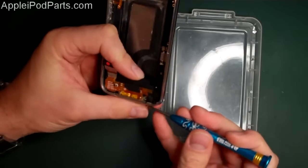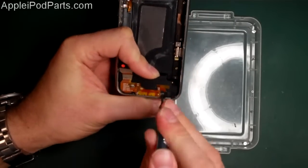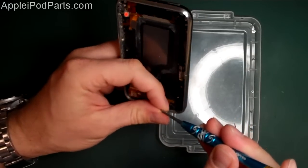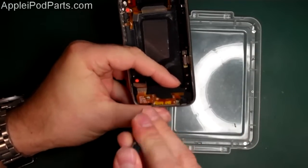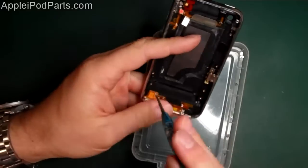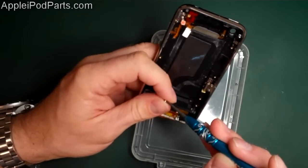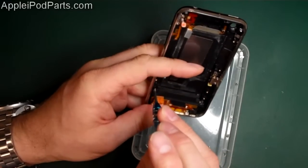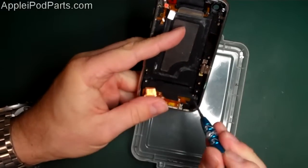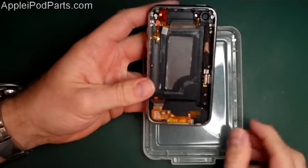So we're going to put the little screws in there. I'll put them both in, but we know that with the left-hand side the brackets come off, so that's not going to do much good, but it's better to have it in there anyway. One screw there, one screw in that side, and then there's one screw in the corner underneath connector four. It's really tricky to do with the camera in the way as well. Now we don't need to put a screw in that side because what happens is the board — the screw goes through the board and clamps that down. So that's the loudspeaker assembly all in, all in your phone, ready to go.